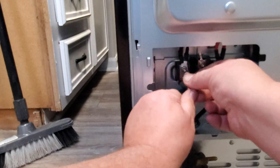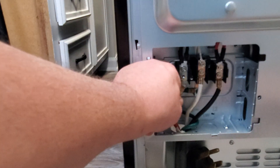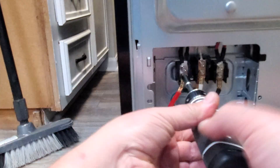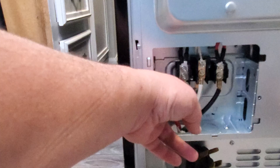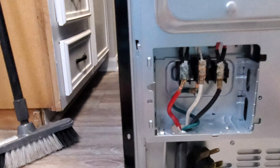If you ask what those wires mean: usually in a regular plug you have only two wires — white and black. White is neutral and black is hot. If you want to run a regular plug you connect either of those two phases. Each one of those phases is 120 volts, so two of them together will be 240 volts. That's why these ovens run off 220 or 240 — it's standard European or Russian voltage.